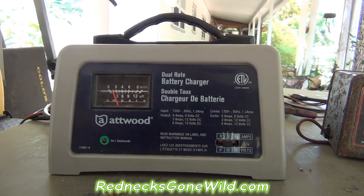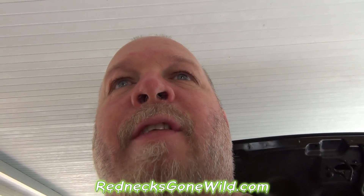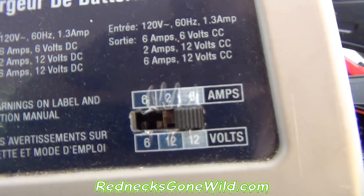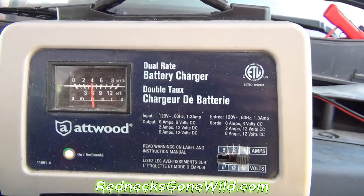What I'm going to do is get a battery charger — this is made for this type of problem. I'm going to get this battery charger on here. Right now I know I've got a dead battery, but I don't know why. We're going to get this car to start by getting enough charge in it, and then we're going to test the alternator. I have this battery charger set on 12 volts and it's putting in six amps. This is not a trickle charge — this is a faster charge just so I can get this thing started.